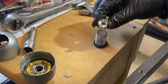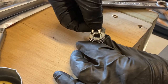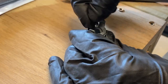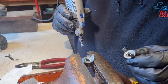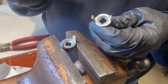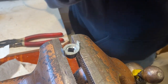That will end up on there, and then we're going to have to push the spring down on that rod so we can get this little tiny C-clip. We're going to slide it on the rod, and then when the spring comes back, the C-clip will fit. It's supposed to fit right into this recess of the spider. On the spider there's a pocket that the C-clip is supposed to fit down in, but I find they don't always fit. This is a stamped one and it's got a little bit of a ledge, but this is pushed down by the spring. The spring should keep the C-clip down in this housing so it can't fall off that horn rod.